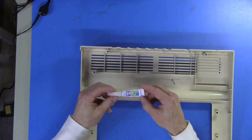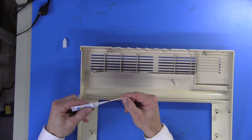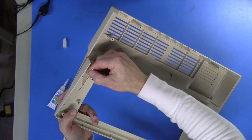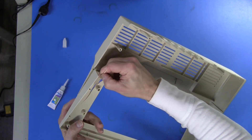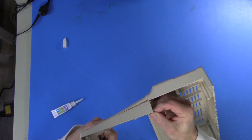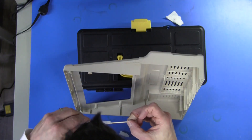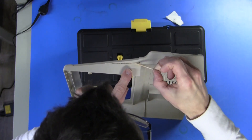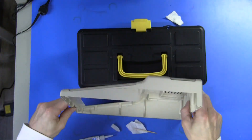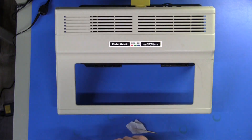The keys and the bottom of the case are soaking. I've already cleaned this top half and I'm getting ready to glue it while the other pieces are cleaning. I threw every cleaning trick I know at this — I used a toothbrush and dish detergent, Windex, Green Clean, and even tried Goo Gone. But what did the most good was the dish soap and toothbrush with scrubbing action. On all the black scuff marks I used a magic eraser, and I think the top case looks pretty good now.